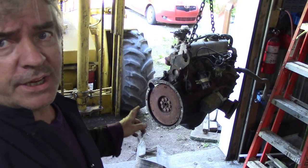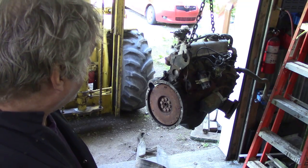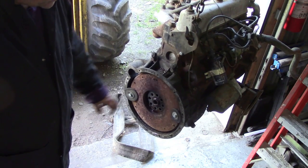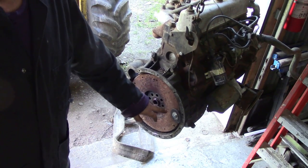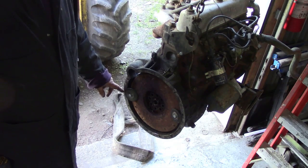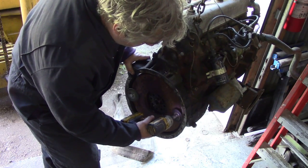So what we're going to do now is take off the flywheel and the adapter, and then we're going to bolt on my second engine carrier, and then we can start to take this to bits. I put a bit of penetrating oil around here, around where the crankshaft is because it is pretty rusty. We're quite blessed with the holes that go through the flywheel that hold the clutch on, and they go all the way through. I've got some big spreader washers which are touching the outside and touching the flywheel and hopefully we can jar it loose, because tapping it with a hammer at the back isn't really the best of ideas.